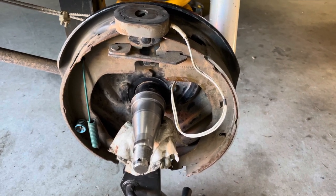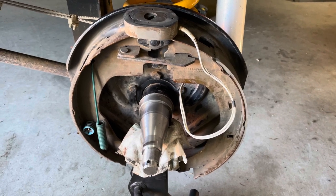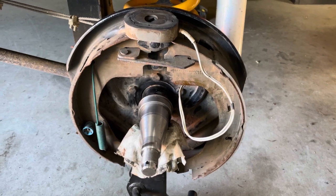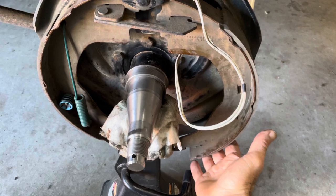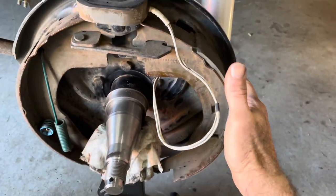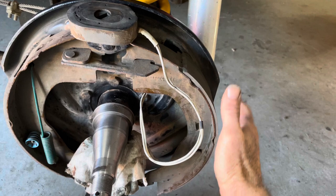So what happens when you're driving on dusty dirt roads? If you watch caravans or trailers with electric brakes driving down a dirt road and slowing down, you'll see all the dirt drop out from behind the drum brake. That's due to dust coming in through the bottom. There's a large vent on the front to allow air to cool the brake, and that catches a lot of dust which then rides up the brake shoe, getting pulled between the drum and shoe while turning.